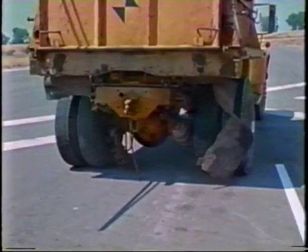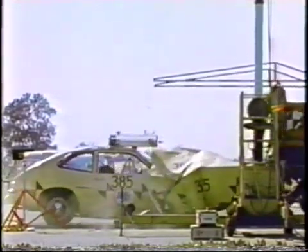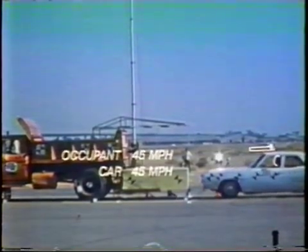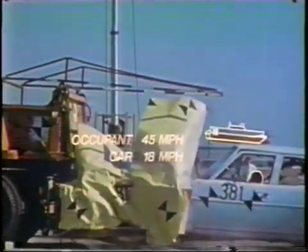Damage to the truck was relatively light except for the drivetrain and surrounding parts, and it was still drivable. The test dummy, Willie Make It, was restrained with a lap and shoulder harness, but these restraining devices did not prevent a sharp blow to the steering wheel with the chin, and indentations were made at the bottom edge of the dashboard by the dummy's knees. One of our primary concerns is the safety of the occupants of the impacting car. While the possibilities of injury in any collision are always present, we were working toward reducing occupant impact velocities below 27 miles per hour. This sliding weight is used to compute the occupant impact velocity — that is, the relative velocity at which an occupant will strike the windshield or other interior surface. Occupant impact velocity is determined by subtracting the slower car velocity, after the occupant has traveled two feet forward inside the car, from the original car impact velocity of 45 miles per hour.